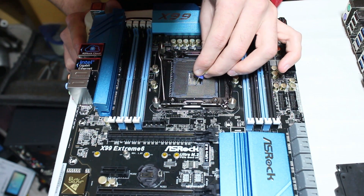In conclusion, if you're going to try this, seriously do it as a last-ditch attempt after you've tried everything else. While you're doing it, really be careful and take your time — it took me about 15 minutes to bend that bottom pin back and get the other two pins out of the way. I was lucky to have another motherboard to use as a reference photograph. If you don't have another motherboard, get a picture off Google of the socket, line it up, compare it, and put all the pins back to normal if you can.